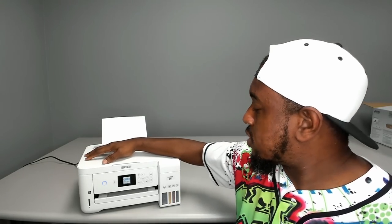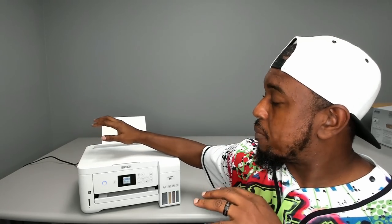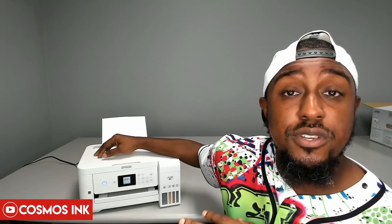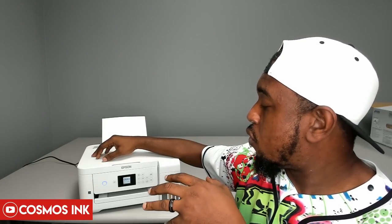Once you see your Wi-Fi name on the screen, press OK, enter your password, and once it's connected you're done. We have officially converted an Epson EcoTank 2760 into a fully functioning sublimation printer. The 2760, 3760, 4760, 2720, 3720, and 4720 are all converted the same way. The physical setup is now complete. Part two will cover the technology side — downloading drivers and tweaking settings for color matching between your screen and the final pressed substrate.